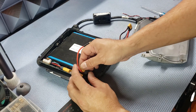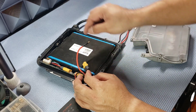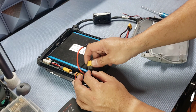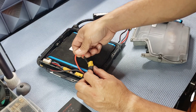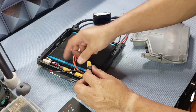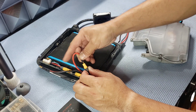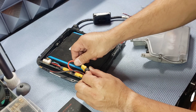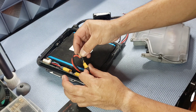Be very careful in this part. You want to put the same color wires together — positive with positive, negative with negative. The bottom one on this connector goes to the bottom one, so positive faces down. Put this connector in first, one by one. Make sure that wire is far away from the other wire, plug that in, and then plug the negative one in — negative to negative.